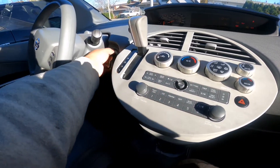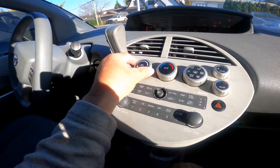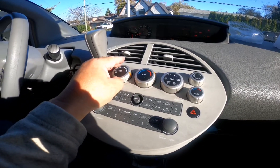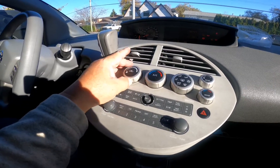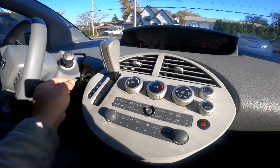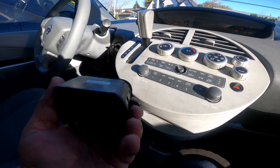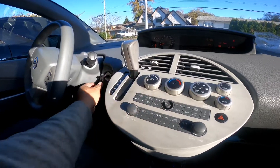See, right now I don't even have to start the car. Once I turn the heater on — see, as you can hear, it's working. Pretty good. So the problem was the blower. Just in case this happens to you: if the blower doesn't stop even when you don't turn on the blower for your heater or air conditioning, something is wrong with the blower. This one was $53 from Amazon. Thank you very much for supporting my channel, Ben's Fix Autos.